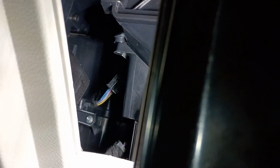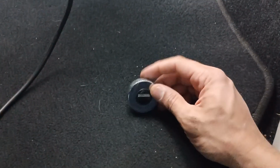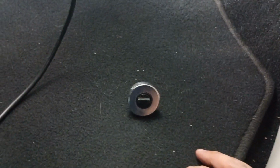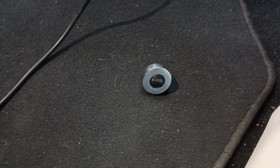You're not going to be able to see it, but I came in through the front here and tightened the 2 bolts hand tight, and I'm just going to tighten them up with the tool now. Tighten them up with my thumb wheel. I'm probably not going to show in the video, but I'm just going to shut the driver's side door, and hear further clicking again. And then afterwards, once I get everything back together, I'll drive the vehicle around and actuate that feature. Did forget to mention to reconnect the harness, or it's not going to work.